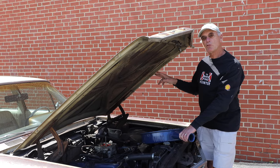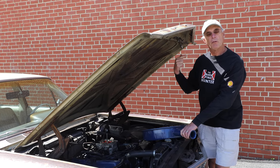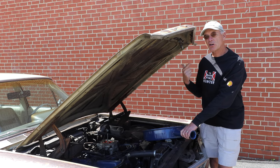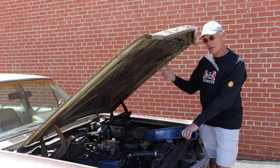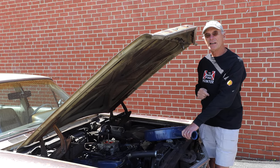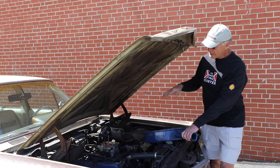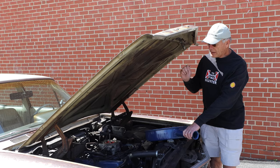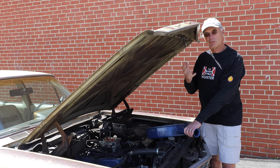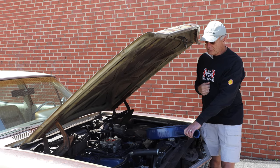You have to put a second fuel pump on this. Fuel injection has not only a pump to move fuel from the gas tank to the unit, but another one to return unused fuel. So you've got two fuel pumps going. The one in the back you can hear — it's kind of a pain in the neck. It returns fuel not used by the unit. You could probably isolate that fuel pump a little better on rubber or build a box around it with foam rubber, but I'm used to the noise — it's no big deal.